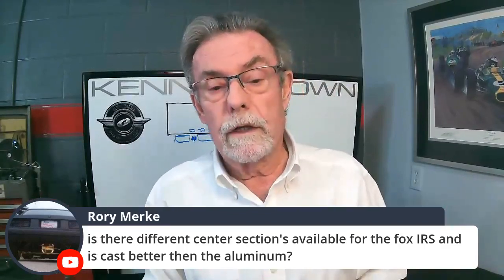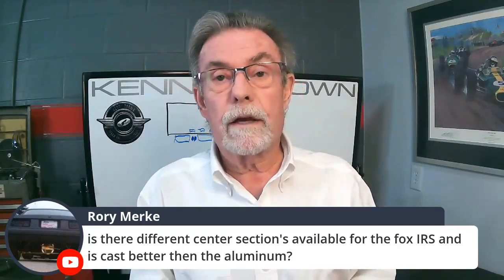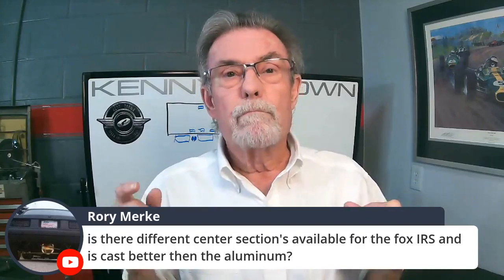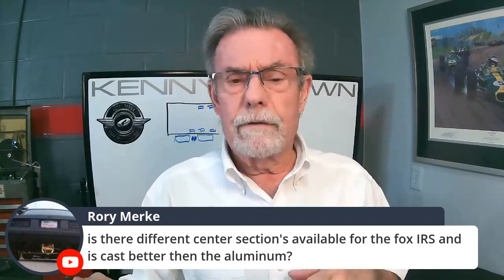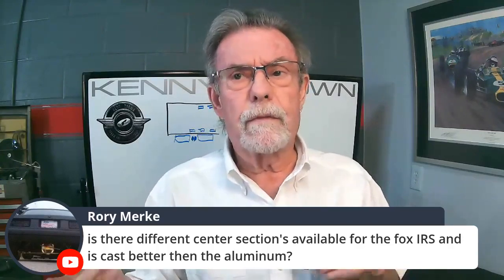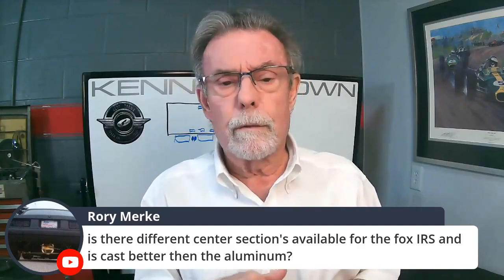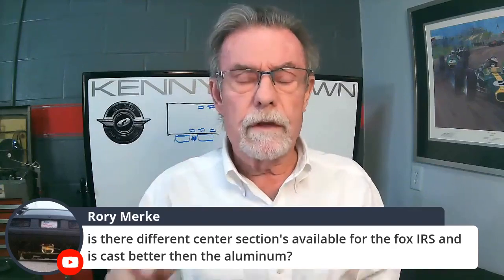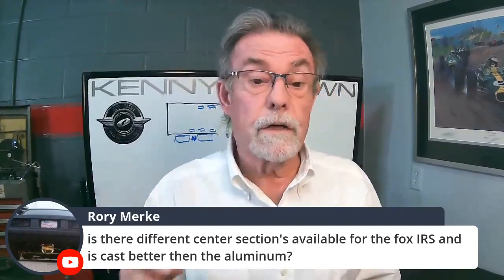But we just recently made an update to that bracket. We put a couple extra holes so that it will bolt on to most Fox bodies. I'm not going to say all, because there's from 79 to 93, and before 86 some of the Fox bodies are kind of strange, but it should bolt on to most of them, to the existing holes for the quad shock.